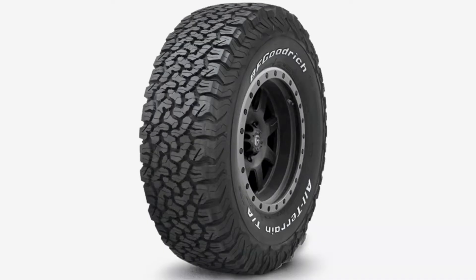The standard tires Jimnys come out with — in South Africa we get them with an all-terrain tire, either Dunlop or Bridgestone. These are not bad tires for normal day-to-day use on the road, getting from work to home and the occasional 4x4 trail over the weekend. Not bad at all, even for overlanding. For overlanding I prefer a tire like the BF Goodrich All-Terrain — a really good, much tougher tire with 3-ply sidewalls that protects you on gravel roads with debris that could slice your sidewalls.